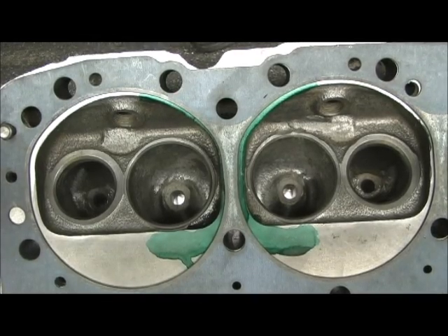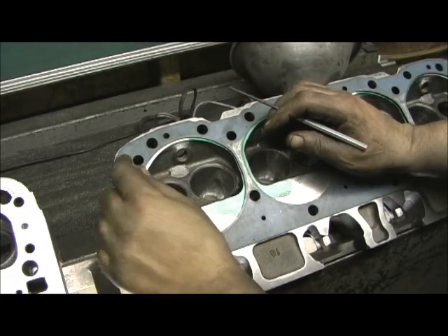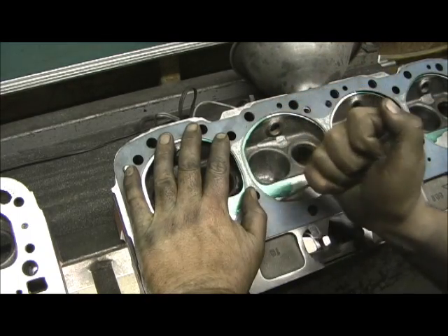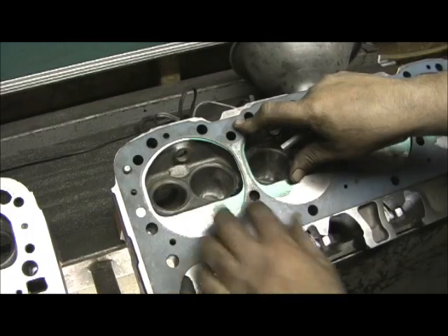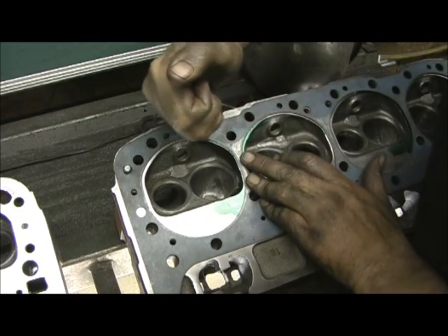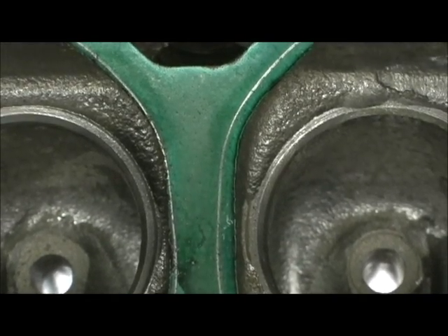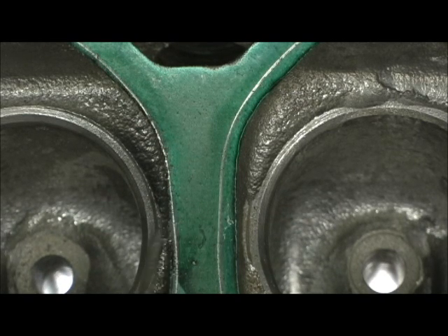So we're going to scribe the line. I'll show you how to do it. Then pull the gasket off and you're going to see the amazing difference. Got our dowel pins on. You always take your hand, even though you've got the dowel pin, and put some pressure against the side — it's going to be cut. And then you make several passes digging deep, because once you take that gasket off, that's it. The older you get, the worse your eyes are — I'm 52 and these are reading glasses. Now I come in here and see — it's just barely got material to even hold the scribe. Now this is where my scribe line is. Look at how much meat I've got to cut out of this side. The line is right here on the edge, just fixing to fall off the chamber. Look at that difference between these two end ones. I'll go in here and dig up this one — I barely got it but touch. You just blend it. You can't go past the gasket ring.